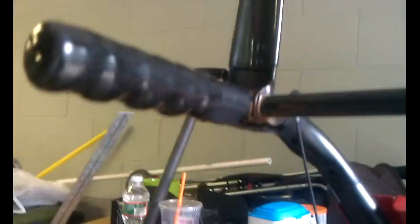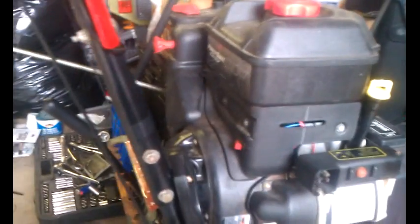Now I just run the wires. The pads are all hooked up. I ran the wires down — if this had a back panel I would be able to hide everything, but I ended up just taping everything back here. This is the control pad; it came with a mounting bracket so I used that and hooked it up. I ran the wires down and hooked up that red wire to the positive right here with a female connector, and the other side just got grounded out to the engine. When you start it up, it gives power to the switch, and then you just turn it on and it'll keep your hands warm.